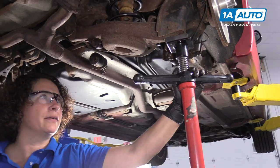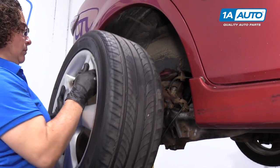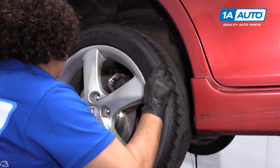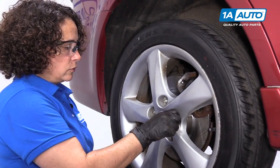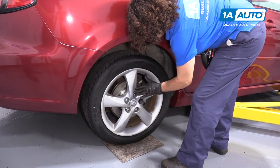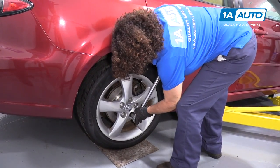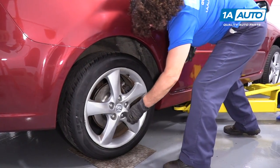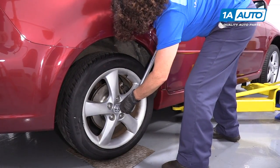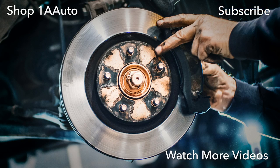Now I'm going to remove the jack and remount the tire. I'm going to hand tighten all the lug nuts until I lower it on the ground, then I'll torque the wheels. Lowered the vehicle just enough to put pressure on the tire. I've got a 21-millimeter socket — the wheel torque is 87 foot-pounds. I'll preset my torque wrench and tighten them in a star pattern. Thanks for watching. Visit us at 1AAuto.com for quality auto parts, fast and free shipping, and the best customer service in the industry.